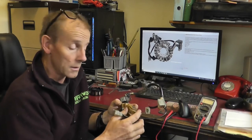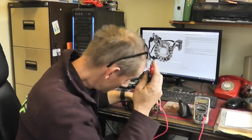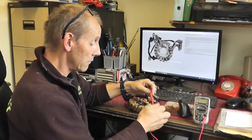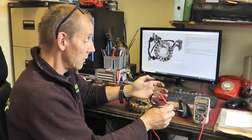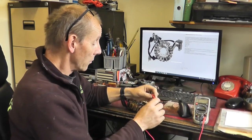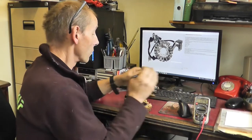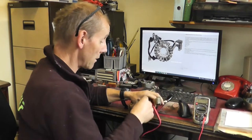These two coils are connected to the white wire and ground, so we can do an initial check on that. Set your multimeter to 2K — 2000 ohms — put one probe on the white wire in the connector. Some of the Honda early ones had bullet connectors; this one's just got a one-piece terminal block. Identify the white wire, put one probe on the white wire, one to ground. We're only showing 100 ohms there. Alternatively, you can put it on a green wire in that block connector — it's reading the same because that's a ground.